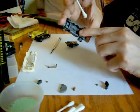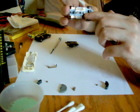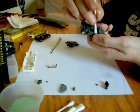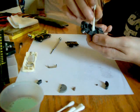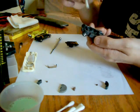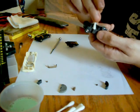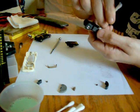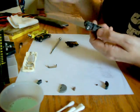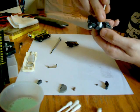And there's two little springs in there that are attached, these metal pieces in the center that touch your brush. Don't touch those. Leave them where they're set at the factory. You can polish them up a little bit if you're careful enough, but it's best just to leave them alone. Take the dry side, dry it all out. This gets all the old settled grease cleaned out. It's quite a bit of it. Everything is nice and smooth.